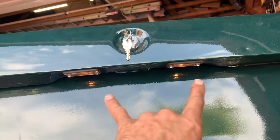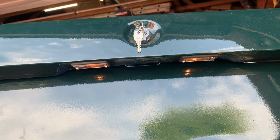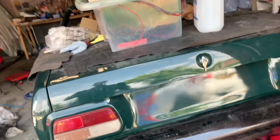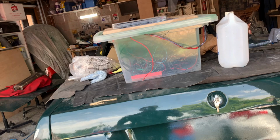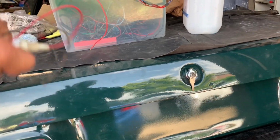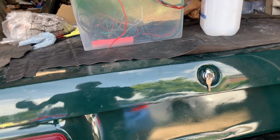It was pointed out to me when I did the electrics that those are not lights for the inside the car. They are in fact the number plate lights. So I fixed those so that they now come on with the side lights. The other thing to note about these is that I had a battery going flat on me at one point, and that's because I eventually realised, and I only caught it because I came out in the evening once, these lights were never switching off, so the switch wasn't going in to switch them off, and so it was draining the battery. So that should be sorted as well now.